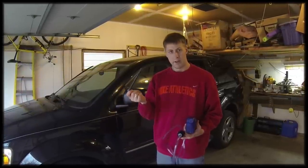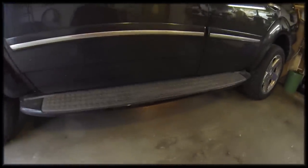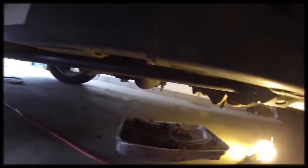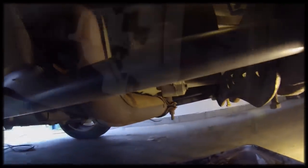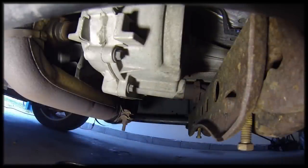You're also going to need a good quality 10 millimeter Allen head. The transfer case is located about midway, basically directly underneath the driver's side seat area in the middle of the vehicle. This is the transfer case — it accepts the automatic transmission output and then selects whether or not it applies power to the front or rear axles. That's the purpose of this.